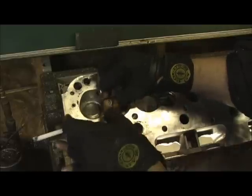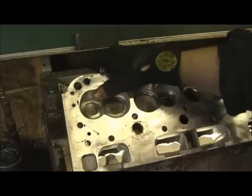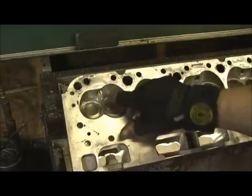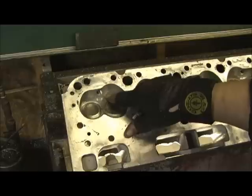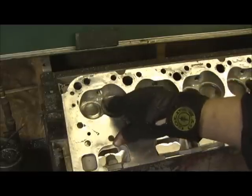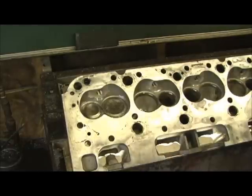You can see where the grinder marks touch it right there — it just barely touches it. Then I pull it out and I know I got the right depth set so it's going to be able, for the electrodes and all that, to be out to burn. Then I go in here and the ridges, I will pull that back and roll it and blend it, but I just can't dig and do what I normally like to do because of compression volume.